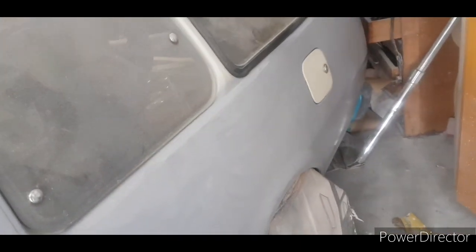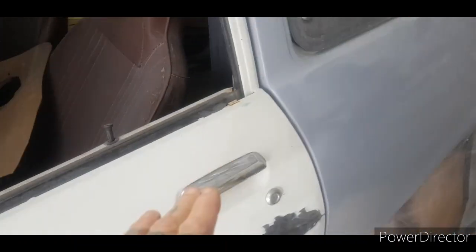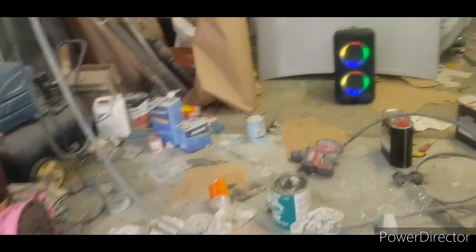With this paint job, I should be able to do it. Just finish these top bits. So yeah, I'll try and get all this sanded as well. But really mainly the goal today will be to panel all these bits, get them finished, get these dents out, so the whole roof can be painted right over. Tailgate, and here, and I can stop, because then I'll know where to blend and continue the paint work. And I'll do the inside of the doors last. Once I've got this main colour on, then I'll focus on sanding them, getting rid of that surface rust, etc.